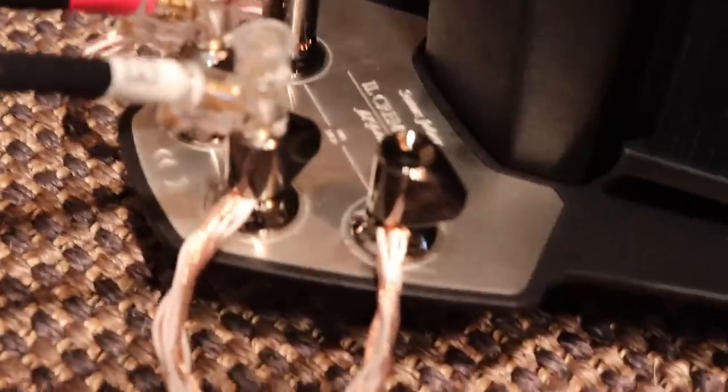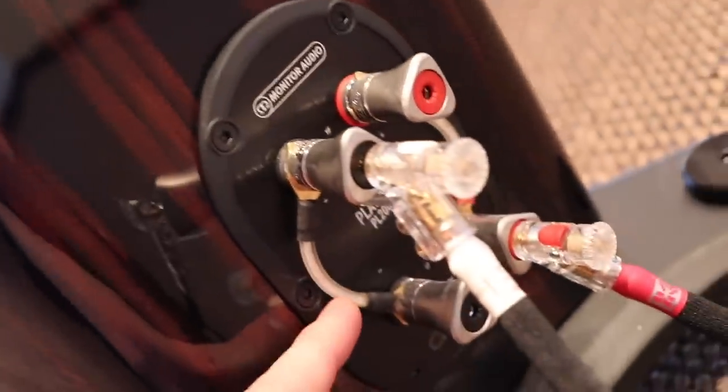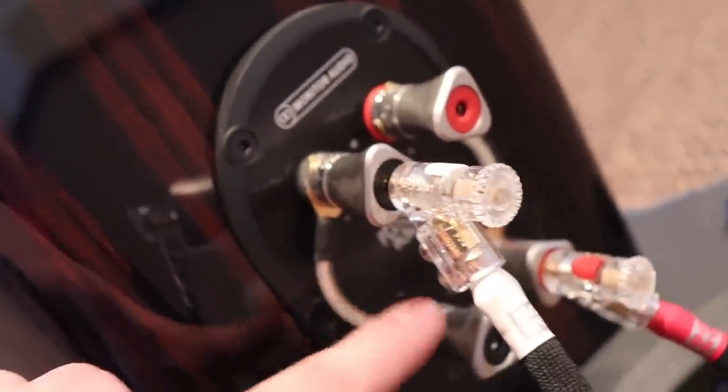To give an example of how it can make it sound better: in a video I did not too long ago with the Sonus Faber Il Cremonese speakers at Soundline during our Audio Research event, we found an incredible improvement in sound quality simply by removing those little gold blades and putting some basic Kimber 4TC speaker wire as a jumper from terminal to terminal. Just speaker wire itself sounded better than a blade of metal. The Monitor Audio Platinum series uses a piece of thick — about 14 gauge — wire instead of blades, which is a quality increase but still not as good as bi-wiring, which I'll show you next.